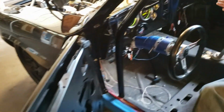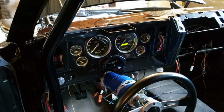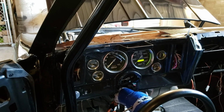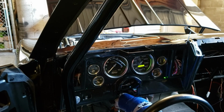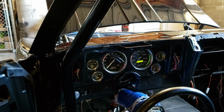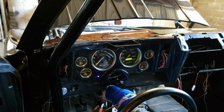We'll keep going around here and walk inside. We've got the gauge cluster temporarily in place. It appears to us that the gauge cluster is probably out of order, meaning there's a dash pad that would go over the top, and it looks to us that that should be installed since the top of the gauge cluster would be mounted under that. So our concern then is the steering column. We can mount the steering column in this, but we need to remove the steering column to do it. So we're thinking this is a little out of order, something we need to talk with you about.